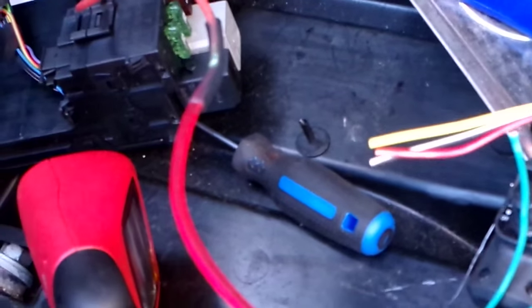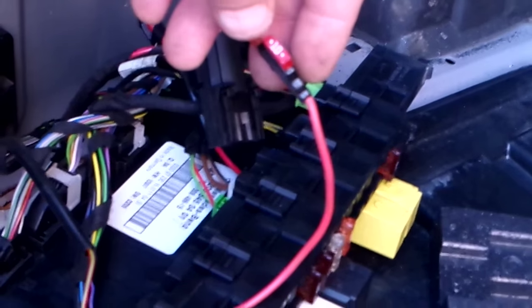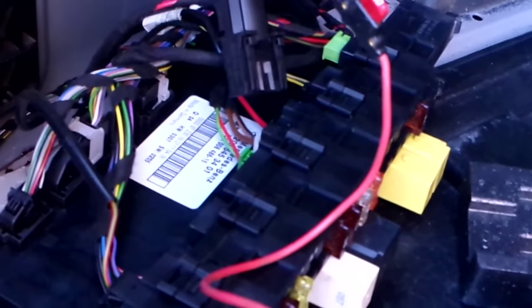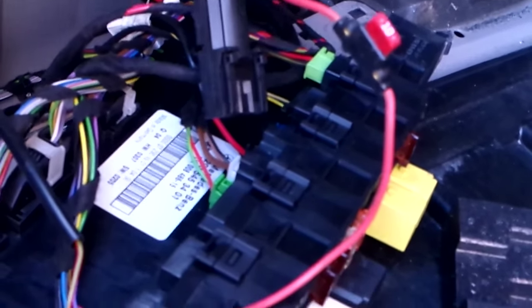I just touched one of the wires to the soldering iron — smells like burnt plastic. Anyway, that's direct power through a 10 amp fuse. I put a fusible link in there so anything that grounds out on the trailer side is going to pop this fuse instead of sending any nasty signals back to the SAM.